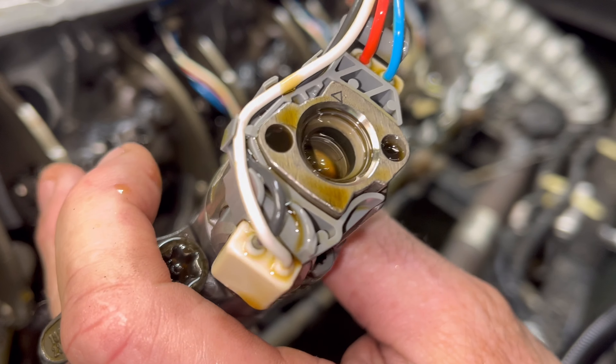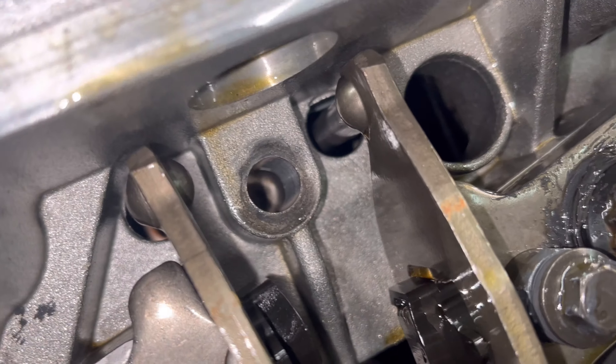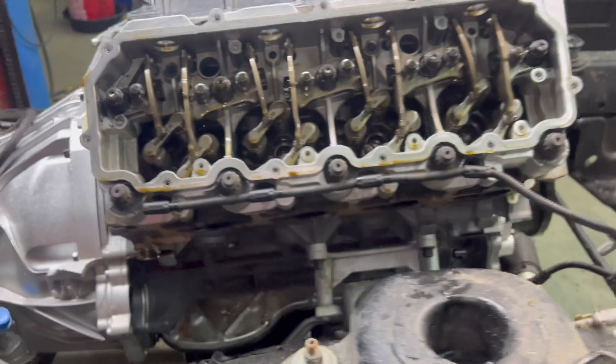I think that screen in the oil cooler did a very good job of keeping most of the contaminants out of the high pressure oil system. Take the 13s all the way out, bust all these loose, and then I'll go bust all the rockers loose. They're just busted loose now — held by the studs only. Turn it down at six o'clock and now we'll get the big impact and bang the studs off.